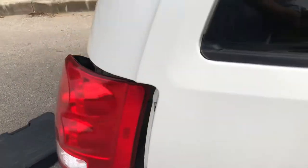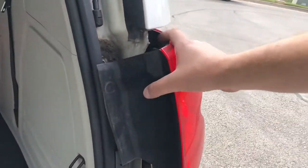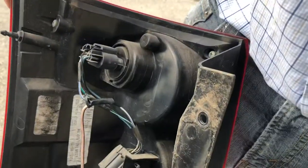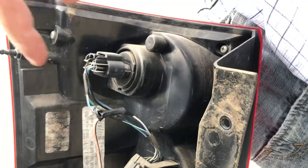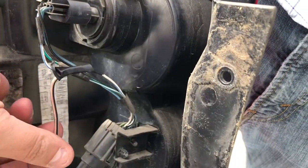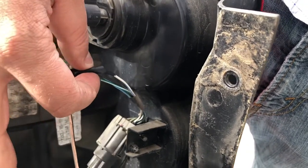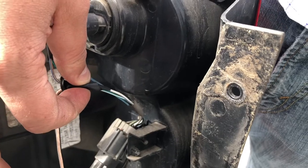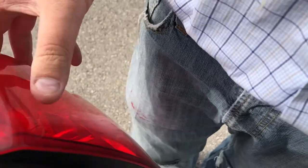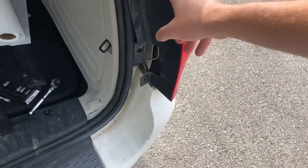In order to do that, all you have to do is take the two bolts off that hold on your rear tail light assembly. The blinker light wire is the white with the blue stripe. So if you get a speaker wire or just some type of skinny wire and you splice into it, then you run it all the way up to the front of the car. Do it on both sides — usually when this happens it happens on both sides — so we connect into the white and blue. Remember, it's white and blue.